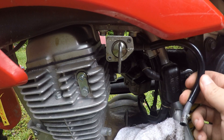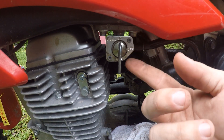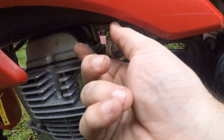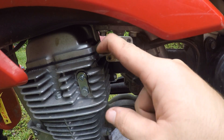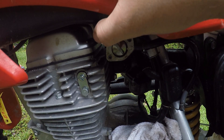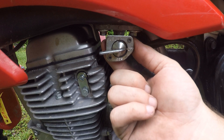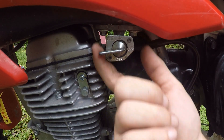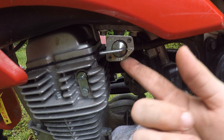Okay guys, as you can see I was draining the gas - a weird thing which is interesting. I've had this happen to me before. This is a petcock valve. Whoever rides dirt bikes - which most of you guys do I'm sure - you know this is just to turn the fuel on, off, and on reserve. I noticed that the gas will only flow out if it's on reserve. When it's on 'on' it's basically like it's off, and 'off' is off. So the only time it's flowing fuel is on reserve, and it might not flow enough fuel. Oftentimes these petcock valves go bad or they're just dirty, so what I'm gonna do is take this one off - it's just two eight or ten millimeter bolts right here - and it should slide out of the tank, then I'm gonna try to clean it and see if there's anything gunked up in there.